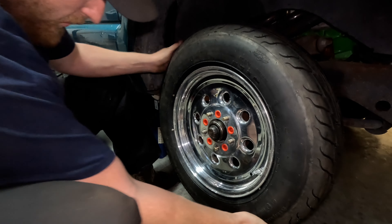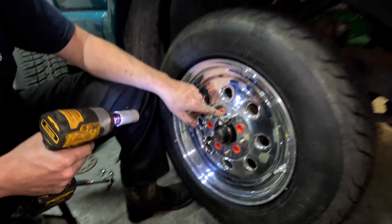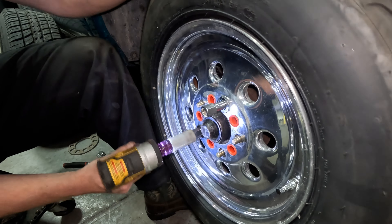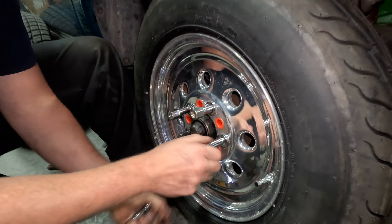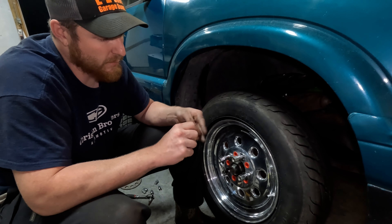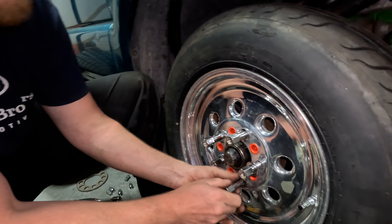Oh yeah, many better! This is why you want to center them up - never tighten them all the way first. Right now I'm sitting on the collar on the inside so it's got it bound up. Loosen them up, tighten them up, back and forth to get them to go. For anybody that doesn't know about shank-style lug nuts: they come with these washers that are rounded on one side. If you buy the Weld brand wheels they'll tell you 'wheel side' - that's the flat side. It's got a bevel and when you torque it down it'll flatten out against the wheel, helping disperse the pressure and keep the wheel torqued.